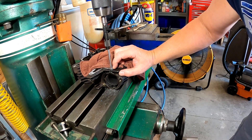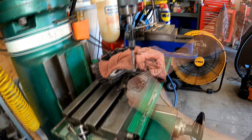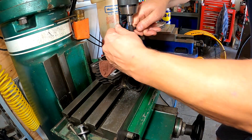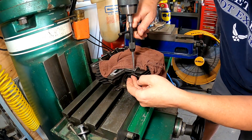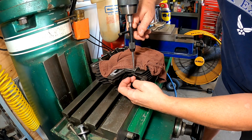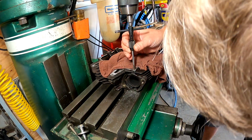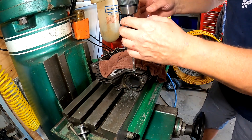It's funny because with the amount of heat we put on there trying to get that out, you'd have thought the JB Weld would have melted. But now that I've drilled out to the minor size, let's go ahead and tap down in there to get whatever's left out. I noticed that hole — that's probably why it was JB Welded. It looks like there's a little tiny hole right there where the manifold gasket goes. I don't know if it's supposed to be there or not. We definitely didn't drill deep enough, so we may have just pushed JB Weld down through a previous botched repair.